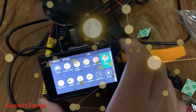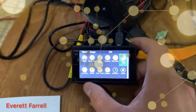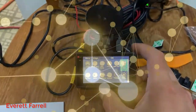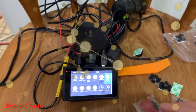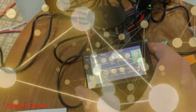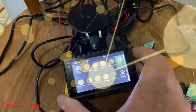Mirror image — I do have this turned on, and it's on by default. Basically if you want your backup camera video to look like a rear view mirror, everything is reversed. Like how ambulances have their name written backwards so you can read it forward in your rear view mirror. With mirror image on, the backup camera simulates a rear view mirror — objects on your left are on your left, objects on your right are on your right. Without it, the image looks weird because the camera is facing backwards. I recommend keeping mirror image on.